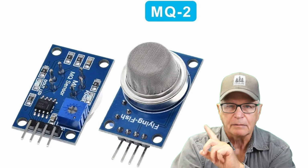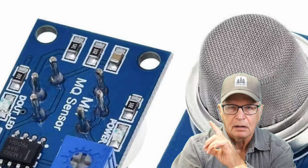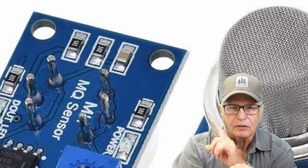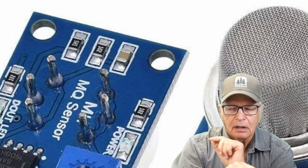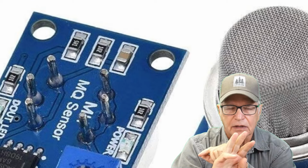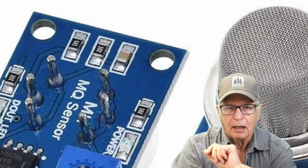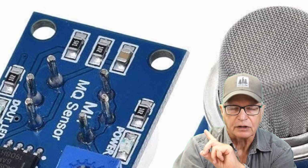Now that's just a Google image I got off the internet. Let's zoom in here. So you see that center resistor? That's a load resistor. You see that it says 102 on there? You can kind of make it out. In the three number system of SMD resistors, 102 means 1 kilo ohm. And I've had some of these ship with that 102 resistor in that position.